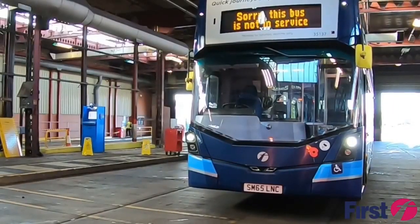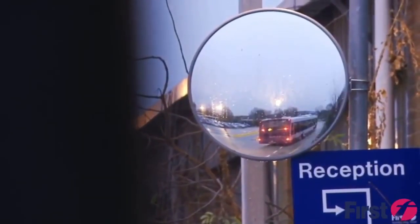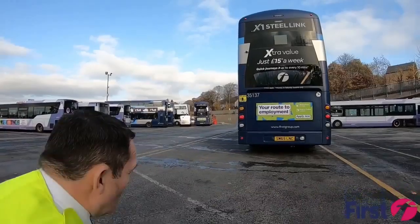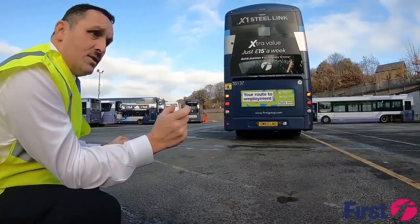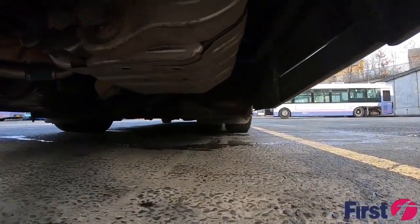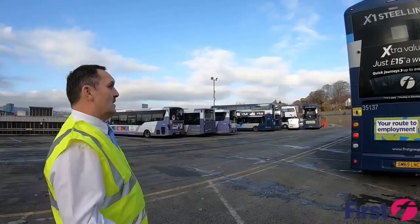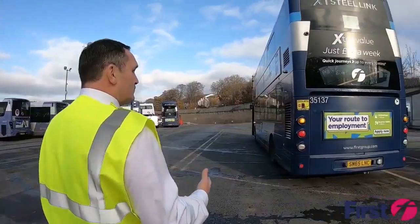And likewise, if a colleague's not available, then we'd need to use a reflective area in which the lights can be checked. And then we can just kneel down, we can actually see that there is sufficient gap between your two rear tyres, which signifies that there doesn't seem to be a problem with the inner tyre. So then we're coming to the opposite side of the vehicle now.